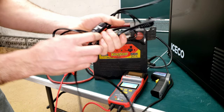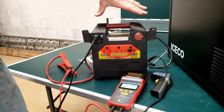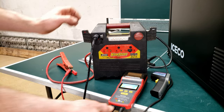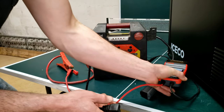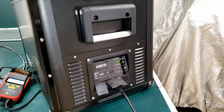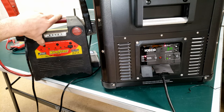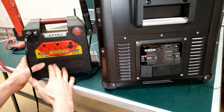The next test is powering it with 12 volts. The power cable that came with it is 10 feet long. It locks in nicely on this particular jump pack — just took this off charge, but this is older and not in great condition. It's showing a state of charge of 96% and 12.76 volts. Hooking it while the power is still on — switching to the other DC port — we got 12 volts, nothing has gone wrong. Shut off the 120 volts and it stayed running without any issues. Four hours later we're still holding 34 degrees with the compressor running, voltage at 12.08 on this battery.